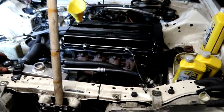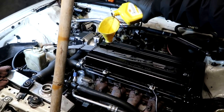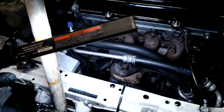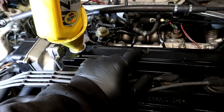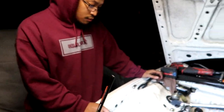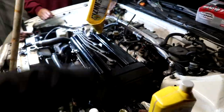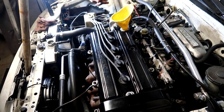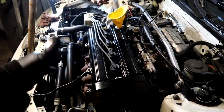Fast forward - we are practically done. Right now we're running the first set of oil for the break-in period. What I've got to do right now is go underneath the car to weld the exhaust up because it is about 11 o'clock. We also broke a valve cover piece, not a big deal since he's doing the VTEC head tomorrow. Other than that we're going to prime the car - take out the injectors, the distributor, and all that, prime it, and we're probably going to do a compression test to see where it's at.